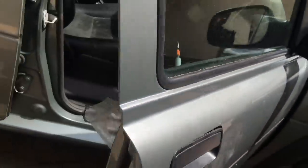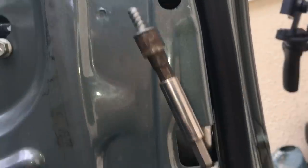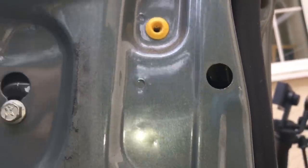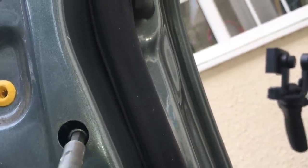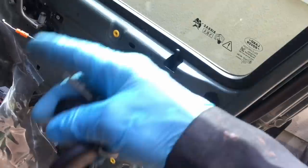The things left now are to get the bolts on the inside of the door handle, which is a little bit tricky. Getting the right-hand bolt in, you need an arrangement with your screwdriver accessing through this hole - just above that orange piece. Feel a little bit with your fingers as well. The secret is to do the left-hand one first - that secures the handle in place and stops it moving. At the same time, drop the lock and take the bolts out, giving enough clearance around the hole for a straight shot at getting that bolt in. Reinsert the cable for the inner handle and reassemble the inside of the door.